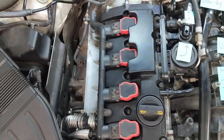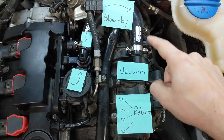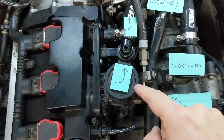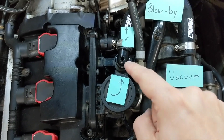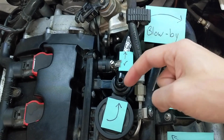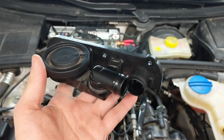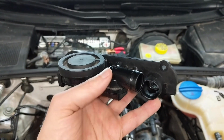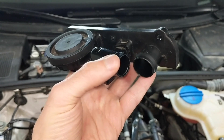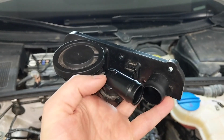Any scenario where you can utilize vacuum to pull air out of the cam cover is great for relieving crankcase pressure. So while a vacuum exists in the system downstream, blow-by will come out of the oil separator, pass through the diaphragm inside of the PCV valve, and pass up and across this check valve. This is a one-way check valve — air can pass this way but never in the opposite direction. To prove the point: a lot of people check their PCV valve by trying to blow into this piece with their mouth, which recreates the scenario where boost pressure is blowing up into the check valve.